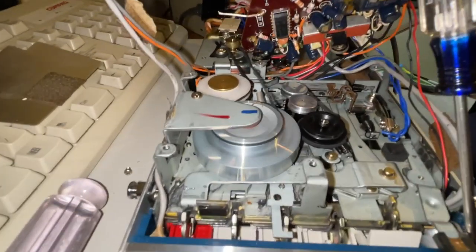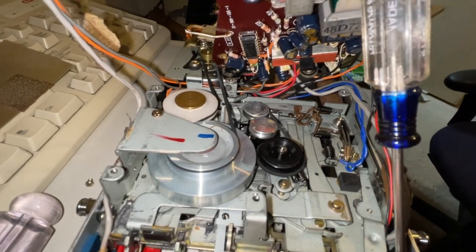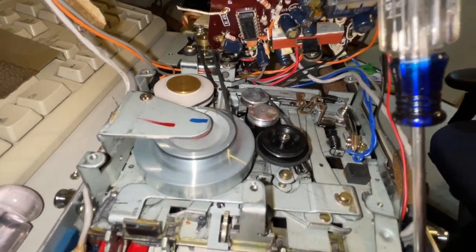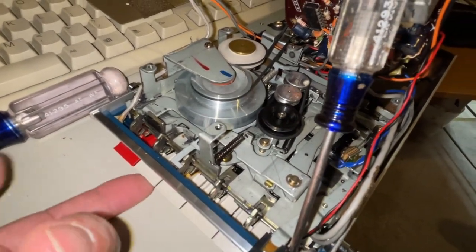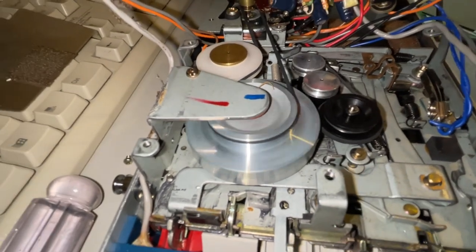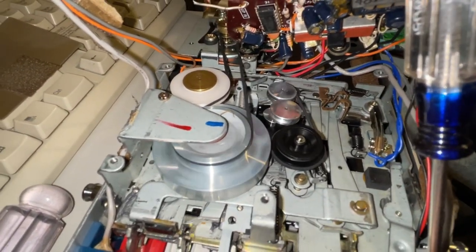With the board now up like a car hood, we can see the other mechanical parts. The reels on the right side drive the fast-forward and rewind functions. In fast-forward or rewind mode it runs faster; in play mode it's a little slower and smoother. When we go to rewind or fast-forward mode, we can see it hang right there - see how it hung? That's what's causing the issue. The belt just spins on that wheel. The motor itself is fine; I've tested it and it doesn't hang. So it's just the age of the belt causing the problem, but overall it plays very nicely.